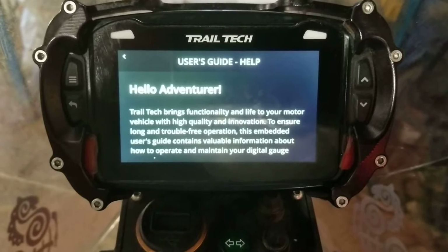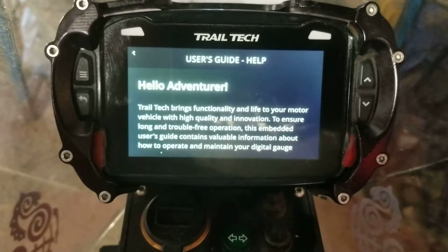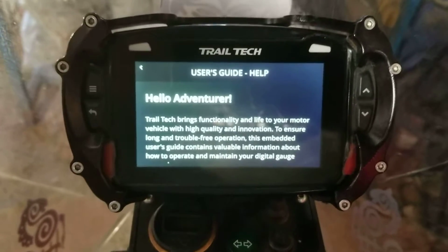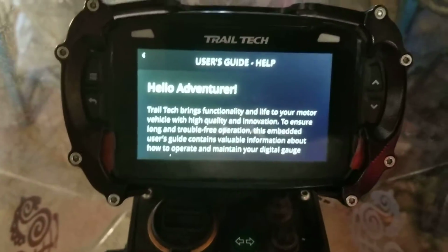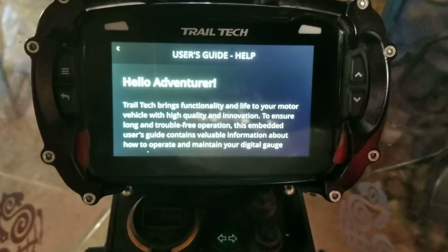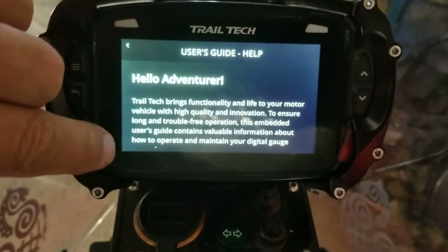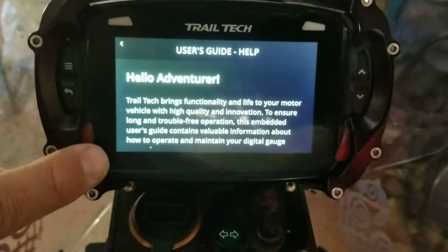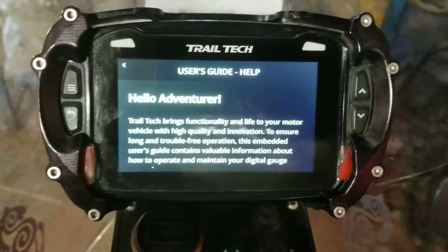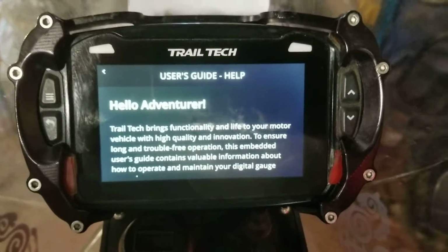But it loses connection, or it gets poor connection, and then all the information like the engine temperature and all that will just get kind of wacky, and I trace it all down to just poor connections on the pins. So I got to clean it up real good, and then I use these spacers in here to push it tighter against the pins and then seal it up a little more.